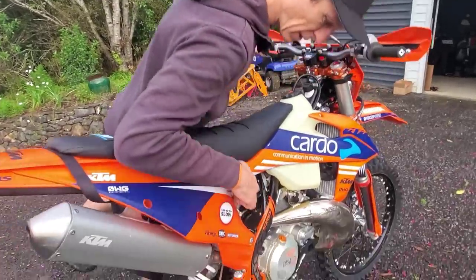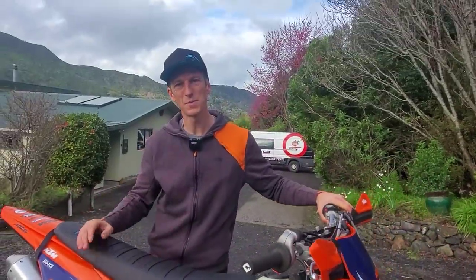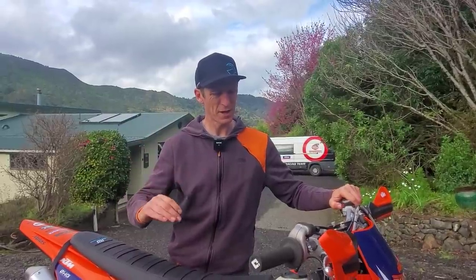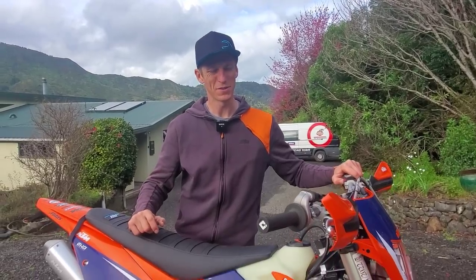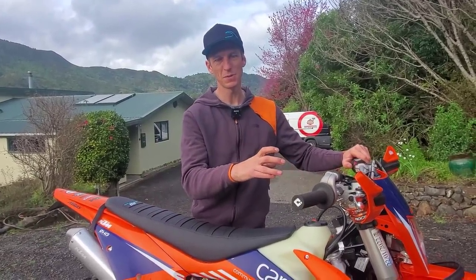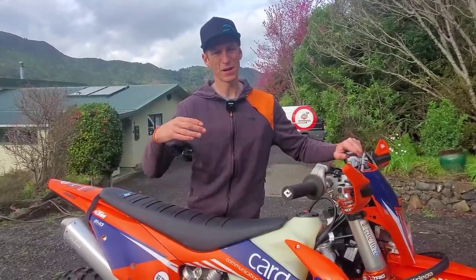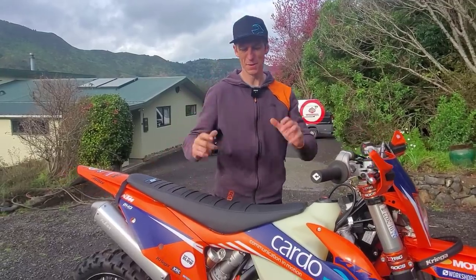I've got the bladder conversion in the back, which makes it a bit more supple, absorbs the square edges better, makes the bike track better. It's not a super crazy soft hard enduro setup — it's soft-ish, a good all-round setup. It gives me a lot of adaptability: a few more clicks of compression front and rear to firm it up for faster races, or open up that compression to get more supple for slower speed races.